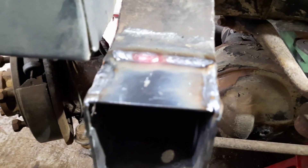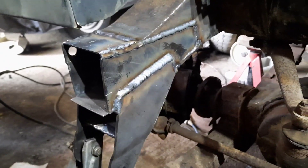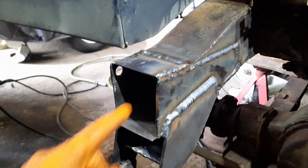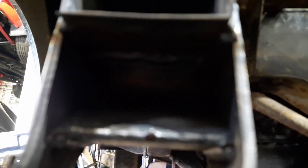Top piece has gone in — finishing up the box section of the chassis there. Let that cool off for a little bit, get the airline to blow any swarf and angle grinder bits out so that's clean. In the meantime I did weld up that little section on the inside — it's a bit dark, might not see — and I welded up that bit too, so that bit's all looking pretty good. The driver's side.